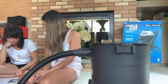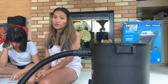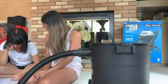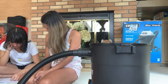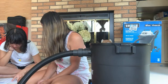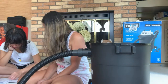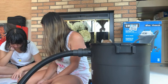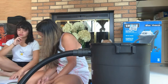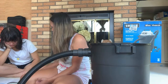Okay, keep going. Do not plug the power cord into the power outlet. Make sure, verify that the power cord is disconnected from the outlet. Make sure that the collection tank is clean and free of dust and dirt. Remove the cartridge filter, then carefully install the foam wet filter over the filter cage. And then place the power head back on the collection tank. For foam wet filter installation instructions, see page 13. Installing cartridge filter. Verified. Okay, that's for the power cord. No. Okay. Installing cartridge filter for water, not for dry.